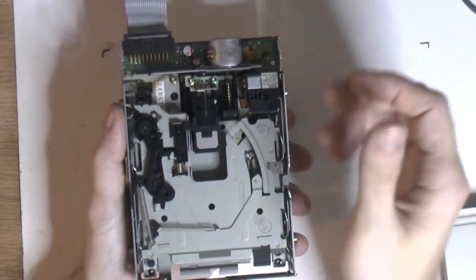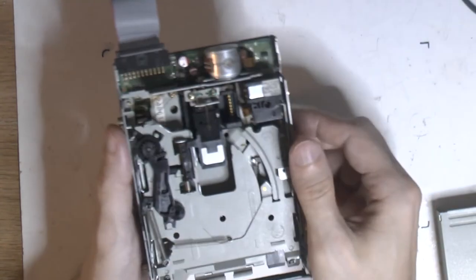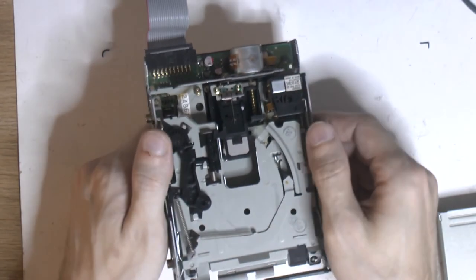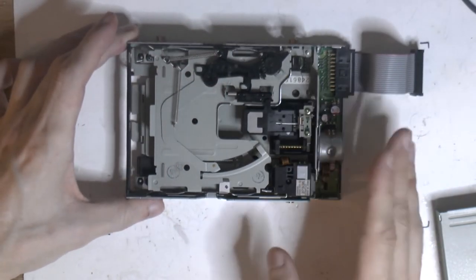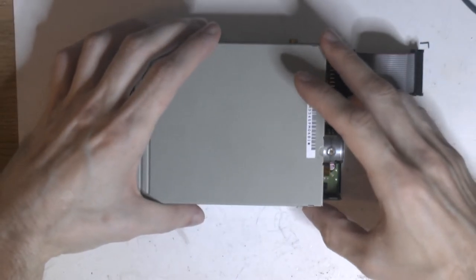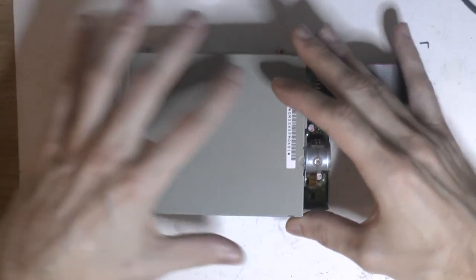It still didn't work after that — the heads moved but every disc I put in said it wasn't formatted, even formatted discs. And the system can read DOS-formatted discs. It turned out it was just dirty heads — the drive was full of dust and even small balls of debris. I cleaned the heads and it worked. So if you have to service one of these floppy drives: if the motor gets stuck and starts humming when you open it up, it's because the circuit board is too far back — push it forward. And if discs aren't reading, clean the heads.